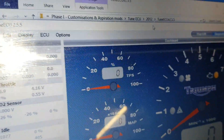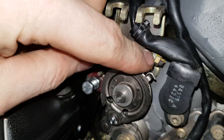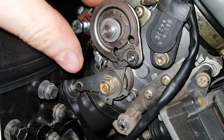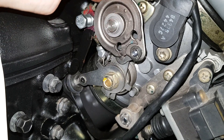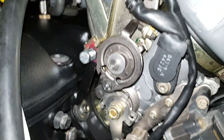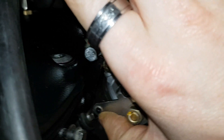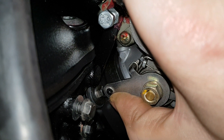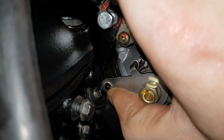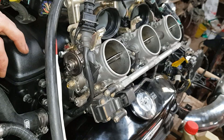I get one hundred percent throttle. So what's gone wrong here? This is what you're opening with your throttle tube on your handlebar — you're turning it to a maximum position up there. Now look at the relative position of the actual throttle down here: the top edge is basically level with the top edge of the hexagonal section — that's about ninety-three percent. But if I rotate it past the soft stop and up as far as it goes, look how much further it goes in comparison to before. Before it only went to here, and now it's gone up here — significantly farther. That's 100% actual throttle.